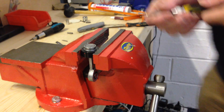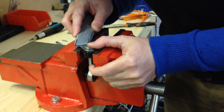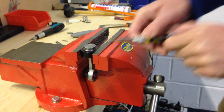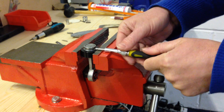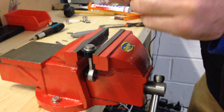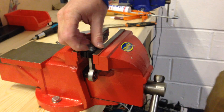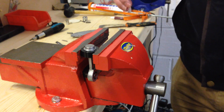Then take the small screwdriver. We might just cut away a little bit more of the seal — cutting at the front and at the back of the seal will leave us enough space to fit the screwdriver in. We can then pry in these gaps to slowly lift the ring. Slowly increase the size of the screwdriver to make the gap a bit larger and allow this ring to pop off. Just do it gently — you don't want to damage the ring too much. There we go, it's off. Once it's off, smooth off this surface and any burrs left by the removal process. Remove any burrs that might damage the new seal. We can now go ahead and fit the new seal.